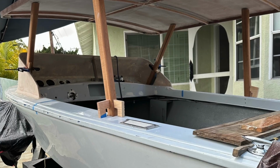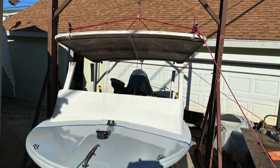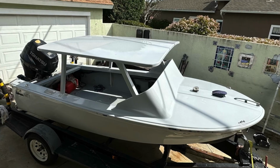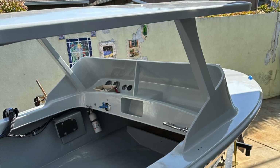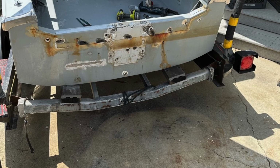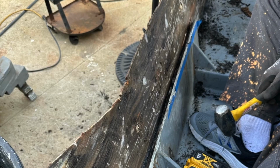The wood of the transom was weakened by 50 years of water intrusion and thus suffered from wet rot. The exterior fiberglass was left in position and the wood transom was carved away. This left a little bit of structural performance as well as a form. The 2 inches of marine ply could be bonded onto with structural epoxy paste.